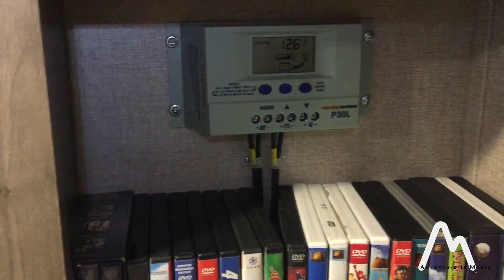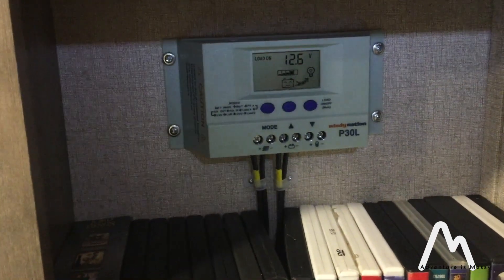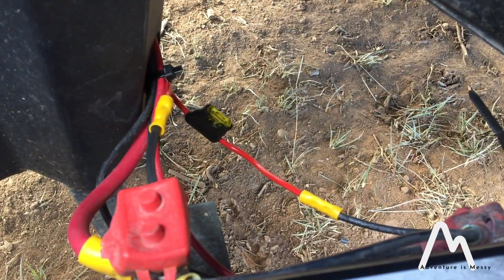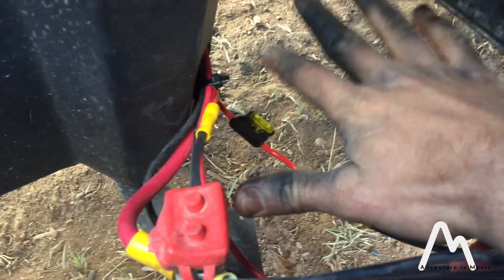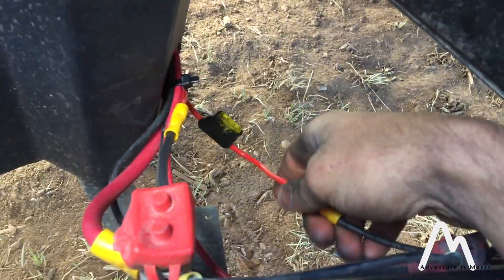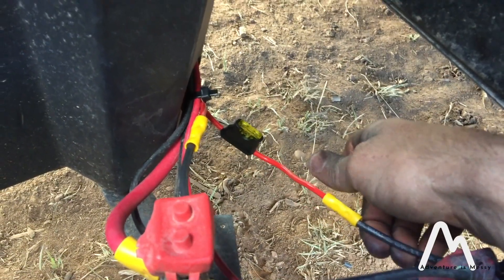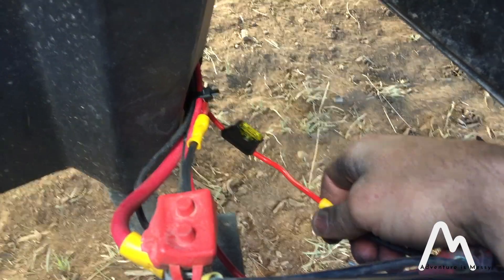That's how I set it up. The cables for the batteries run all the way down through the floor and then up to the battery. The only thing I did that was special was I put a 20 amp fuse in place on the hot side, in between the battery terminal and the panels. And there is my little 20 amp fuse. What I did was I just cut my 12 gauge wire that was supposed to go straight to the battery and used some butt connectors to put that in line. My hands are all dirty — I've been doing some spray painting today. 20 amp is the right size fuse for 12 gauge cable. It's supposed to blow if the cable gets too hot, instead of starting a fire. Just a little safety precaution.